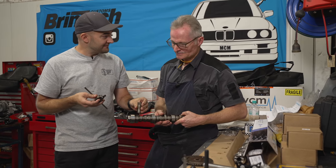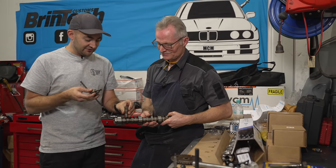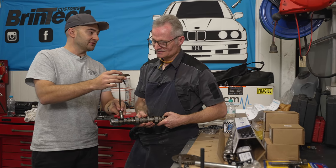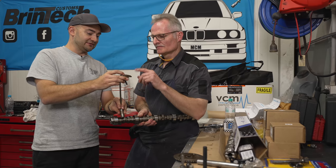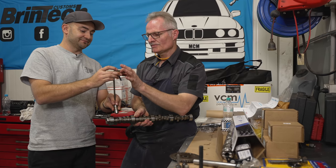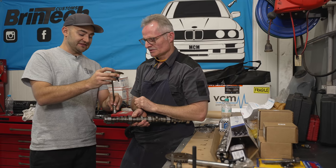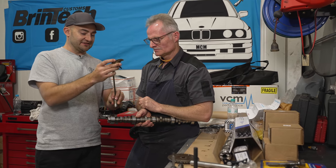You've got your lifter that sits on there and rolls around. Your pushrod pushes it up through the head and then you've got your rocker arm, and that's pushing on the top of the valve. There's a pivot point here, the fulcrum in the middle - the trunnion - and then that's touching the valve tip here. There are different ratios and things that change with that.